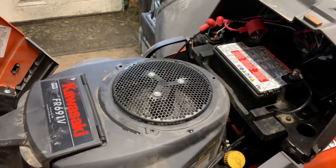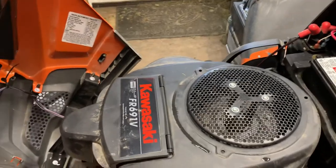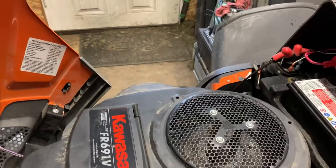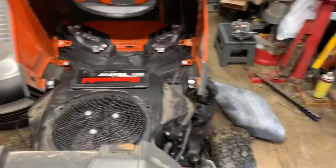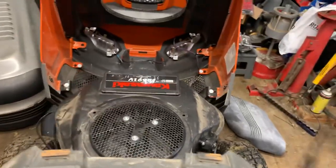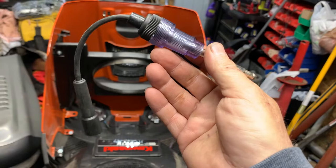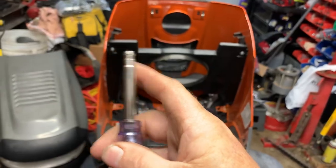Everything's fine. The next thing I went to is checking the motor to see if it's firing good. You can use some spark plug testers just for firing. Let me grab them here — my shop is really packed — but you've got these testers. The basic simple one you plug onto your spark plug and the boot of the coil goes on here.